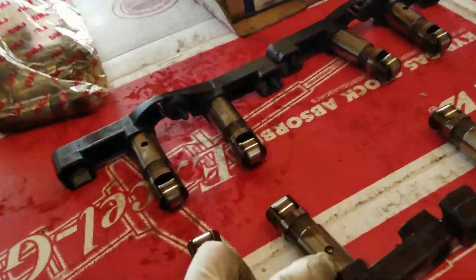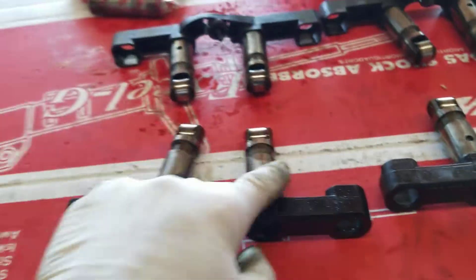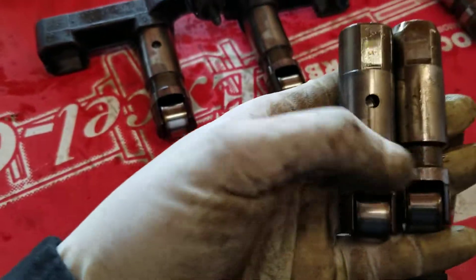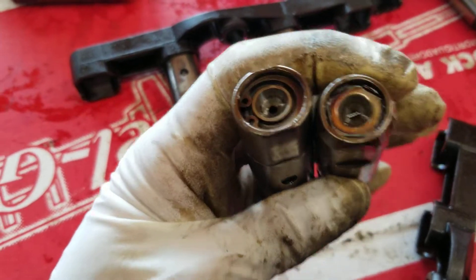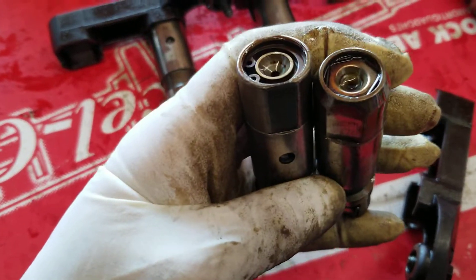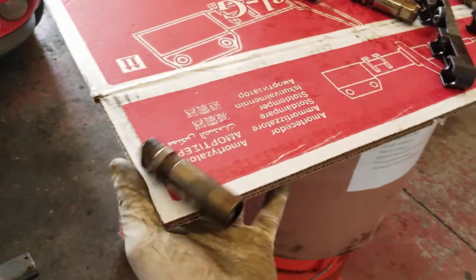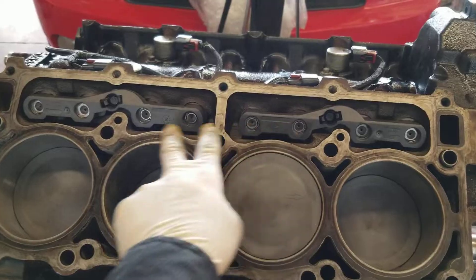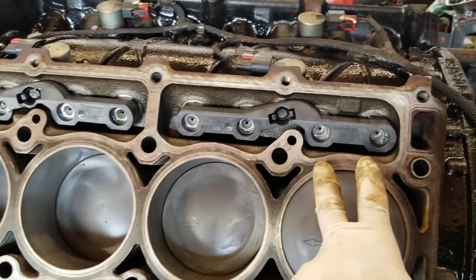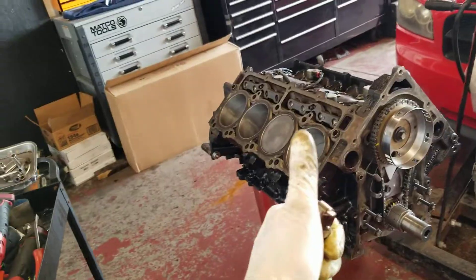When I say hole, this is the hole — see how this one has it? The front or rear one doesn't have the hole; this one doesn't. Let me remove this one so you can see. Check that out — see the hole in there. Look at the difference on the top: the little conic thing. So the one with the oil relief hole goes in the middle on the passenger side, and on the driver's side the ones with the hole go in the front and in the back. So you don't get confused — that's on any Hemi engine. Always remember that. Quick tip, thanks for watching.